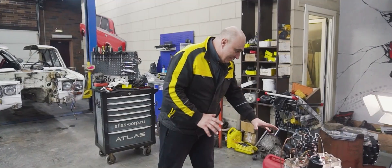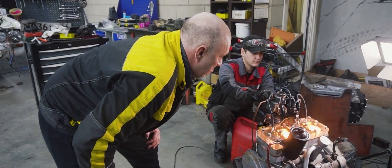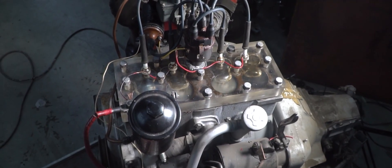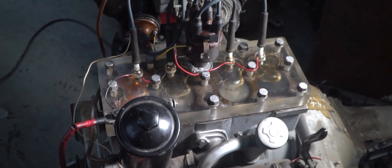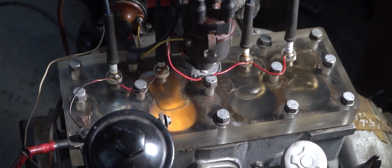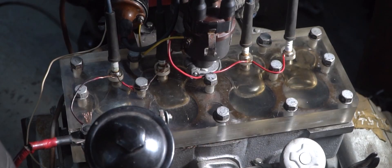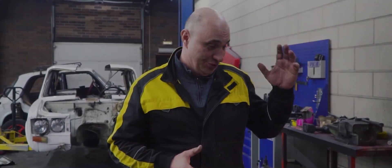You can see everything going on in there — the combustion, how the mixture enters the cylinders. It all works. And you can tell that cylinder 4 is misfiring. We do seem to have spark, but perhaps the valves are maladjusted, or we didn't tighten the head down enough on that side. We were being careful with that to prevent the plexiglass from cracking — despite it being thick, it's still fragile and can easily crack if it deforms. Anyway, the point is you have an excellent view. Everything works, and it looks fan-freaking-tastic — so mesmerizing you could sit here looking at it for hours.